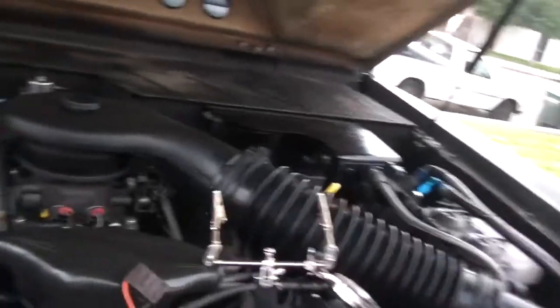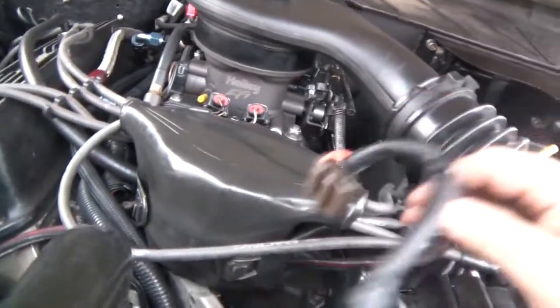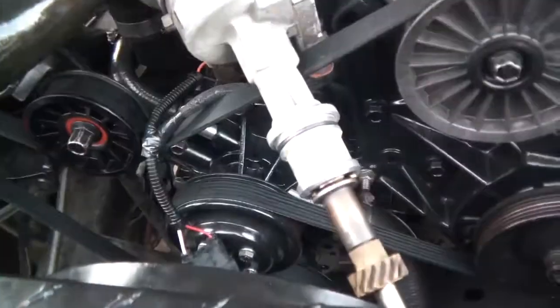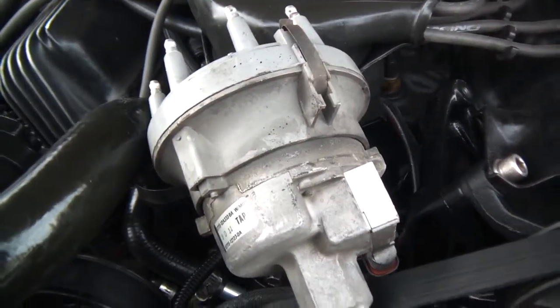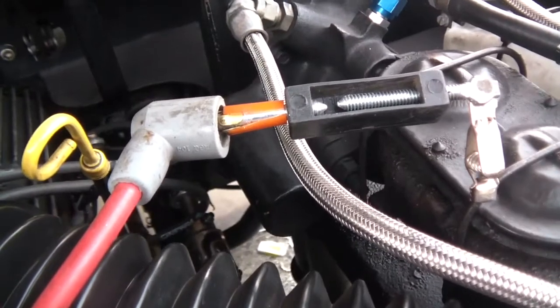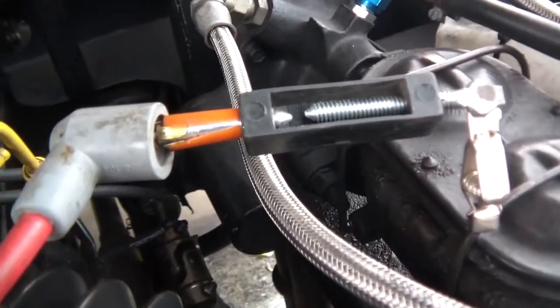I'm going to show you how TFI works. I'll hook up an extra distributor and I'll show you how it works with a coil and a ground wire. So I've hooked up to my extra distributor here, just unplugged from the main engine, and on my TFI coil I'll just have a wire come up and ground it out there. It's not even a good ground, but as I spin the distributor with my hand, it's going to fire the spark. See? This is not a really good coil but you kind of get the idea.